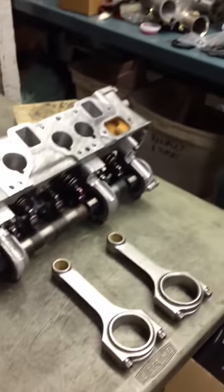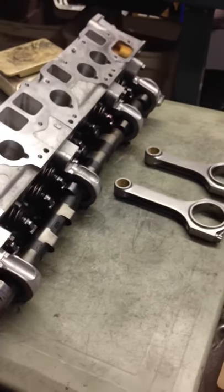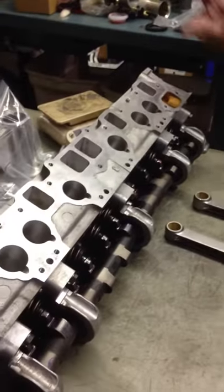Here in California, pump gas is 91 octane. That's part one of the build and we'll keep you guys informed as the other stages come along. Pistons are going to be here probably tomorrow and we're going to start doing the machine work on the block. For viewers interested in this build, when we finish the development there may be a kit available. With the 3.2s we could never sell the kit because we couldn't get enough cranks — we'd only build them here because they used a diesel crank. The benefit to this is it's going to be a little more money, but when we complete development there will be two motor packages: the short deck motor and the long deck motor, available in kit form, and we can have as many cranks made as we want.